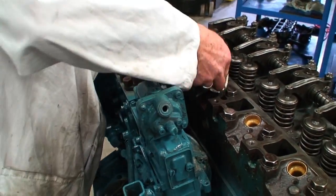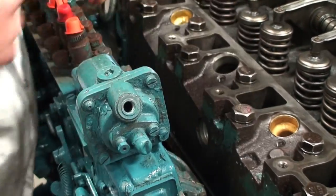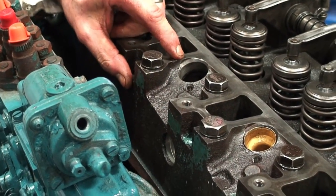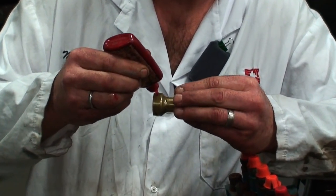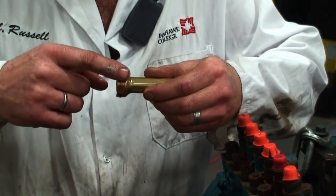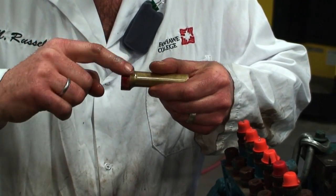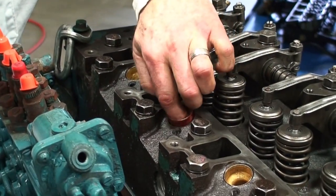So we want to do an inspection here — clean the bore, a little bit of brake clean on the rag, make sure the bore looks good, and then we can have a quick look down inside. Now we're going to take our new sleeve and put on the appropriate sealant, which is 262 Loctite by manufacturer's recommendation. I'm just going to smear this around to give a nice film coat on it, and this provides the sealing of the cooling system with the interference fit of the sleeve in the cylinder head.